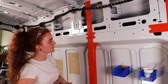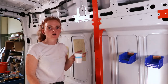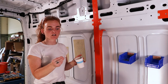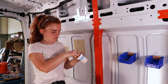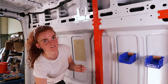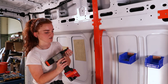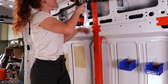I'm also going to take out the set screws after drilling out all these holes just so we can rust prevent behind there and they're not in the way. We have all of our 3/16 holes drilled out for our pop rivets. Instead of coating all the holes individually, I usually just put my rivet in my rust preventer and it coats inside the hole really nicely — you don't have to mess around with a brush, but either way works as long as all the exposed metal gets coated.